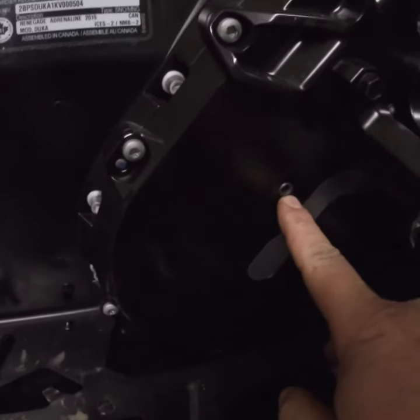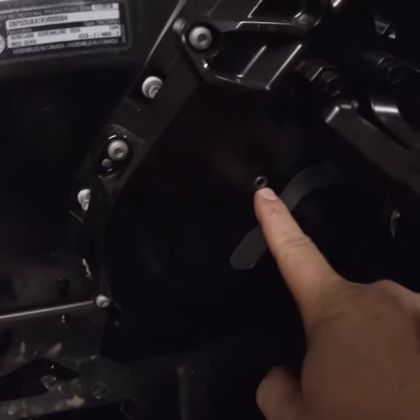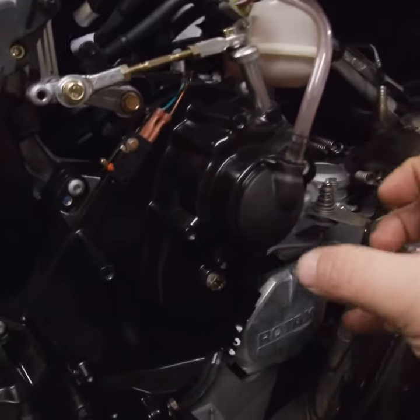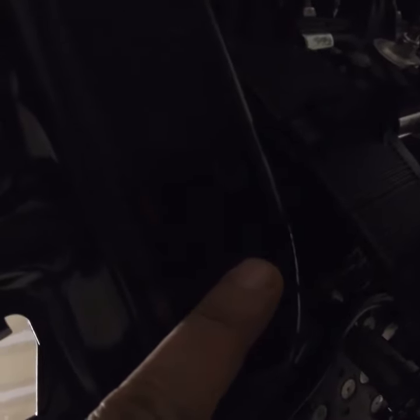On this sled you have a couple of things to look at. Right here is the sight hole — you'll pull this plug, but not yet, obviously, until you drain the chain case. The fill point is right here: you're going to pull this vent tube and pop this rubber cover off, and that will be your fill point. The chain case drain is down here at the lowest point of the chain case, in a hole right here. That's a T30 drive — it goes right up in that hole. Pull that out to drain your chain case lube.